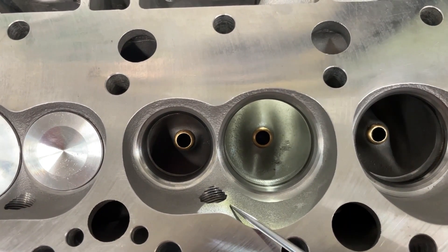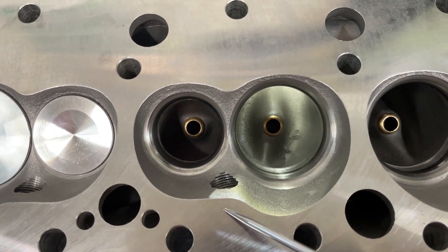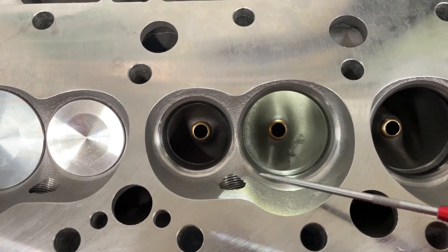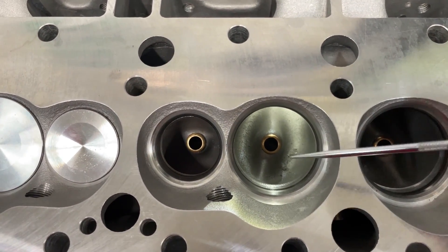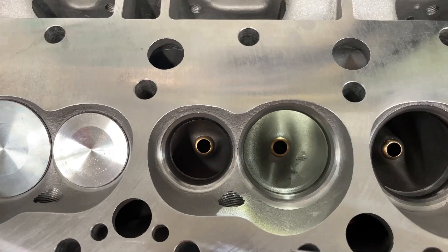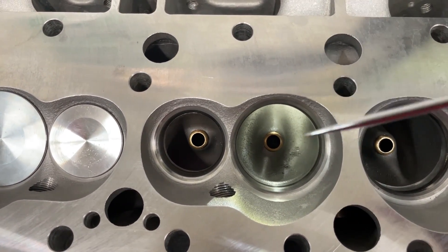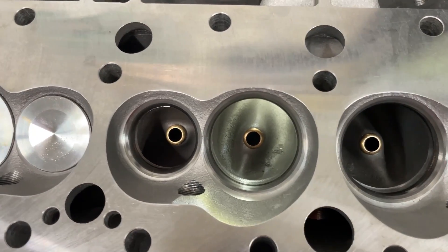I do like this chamber design, but I'll warn you — because of this chamber design, the low lift flow especially at 400 lift is never as good as the Brodix stuff or the Profiler where the chamber is more open. The reason is that at 400 valve lift, this whole spot is blocking the flow out. It eliminates some of the area the air needs to get out. So the 400 lift number won't be great — as soon as it starts opening more, it has more path to go around and it cleans itself up and flows better. On the flip side, you've got more quench pad area right through here, which helps it burn better. But in a dome situation, the dome keeps hitting it anyway unless you get the special JE dome.